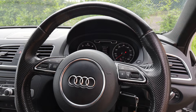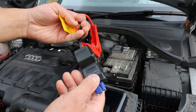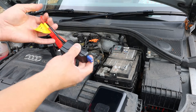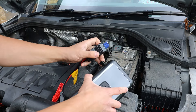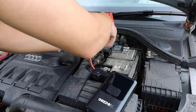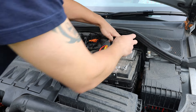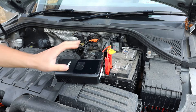I'm going to pop the bonnet and connect the jump starter. If your battery is completely dead and you haven't even got lights coming on, there is a boost button — once it's connected and you press it, it goes green, but you have to wait 30 seconds before starting the vehicle because it pulls up all the ECUs and gives the battery a little bit of life first. Just plug it in, the screen comes on automatically, and make sure you get the polarity right: black to negative, red to positive. The green light comes on confirming everything is correct.